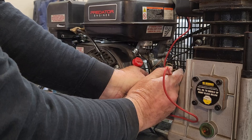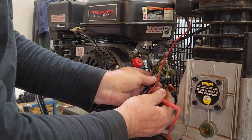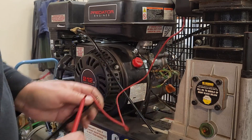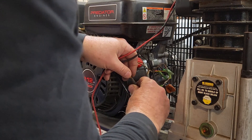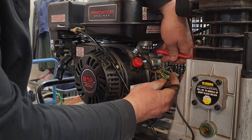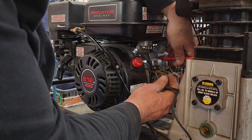And it's reading open. Let me get down here, make sure I'm getting the right spot. I'm seeing what appears to be an open — I think we'll need to bring a light in here to be able to see exactly what's going on. That sensor only has one wire coming off, so it's probably going to the case. So let's go between here and the case — it appears to be an open circuit. So that's probably right; it probably needs to be open, and then it probably goes to ground if the level's low.